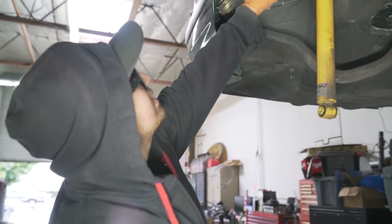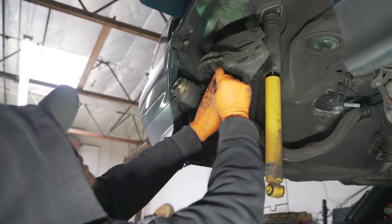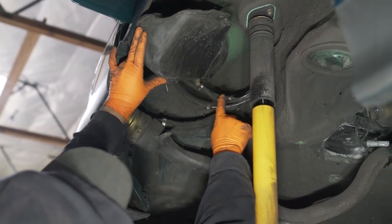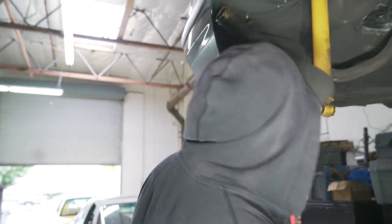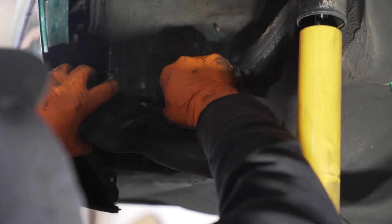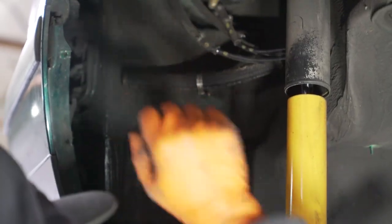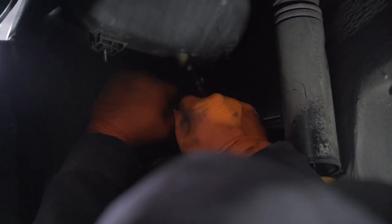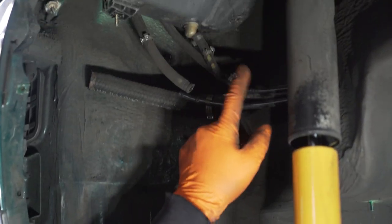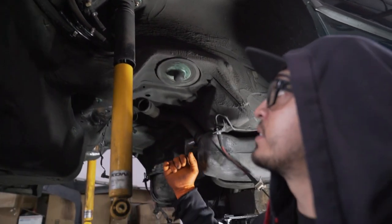Remove your fuel cap, remove the box — it's a 10mm — it all comes down together. Next we're going to disconnect all the hoses: disconnect it from these three and that one, then slide it all out. Wear safety glasses. For these three hoses, I'm actually going to put a mark — and then use this really tiny pick to try to slide it in there and break it loose. Repeat the exact same steps on the other two lines. Now that all these are disconnected, I'm going to remove the last two remaining brackets and start lowering it.